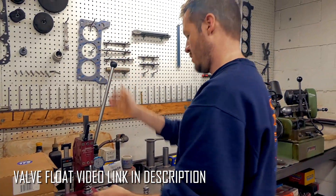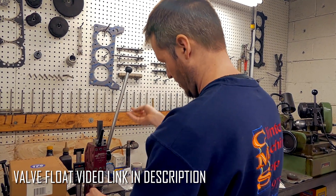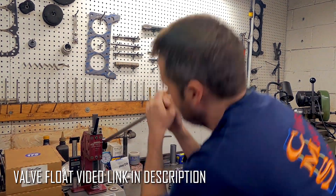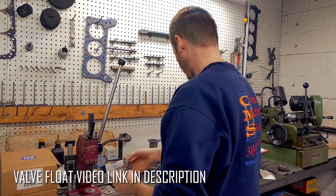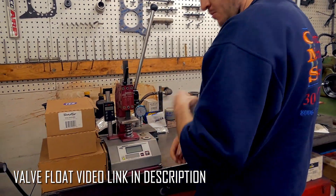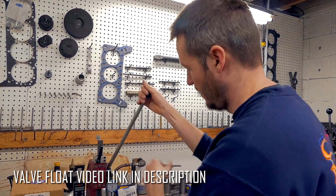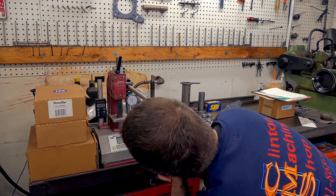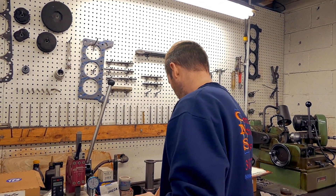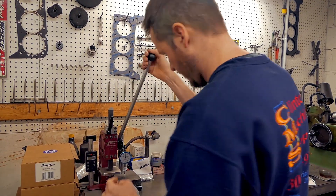There are some pretty interesting videos on YouTube of high-speed valve trains and what a valve spring looks like in some of these engines when it's running — and it surprises you that stuff doesn't break. They're just basically doing circles in there. Even when the valve is not being opened by the rocker arm, you can see the coils will still do that little wave, dance up and down the whole time. That's horrible. But that's the whole theory behind installing them close to bind — it gives them less room to surge back and forth and create all sorts of weird issues.